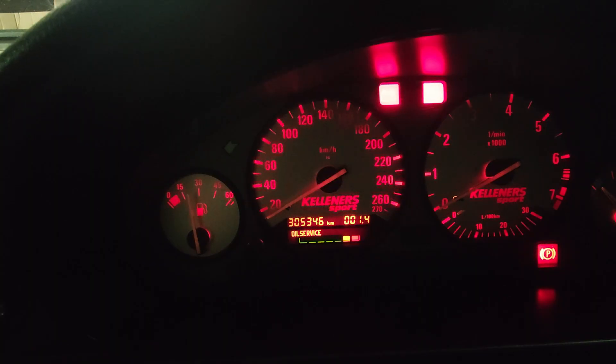So that was a waste of time advancing the cam back to stock. Apparently the retardation I had done was already very good, because in the logs now with the stock straight setup it's clearly making less power. I just went back and tapped it back the other way — retarded it again — and it was clearly shown in the logs. Full load at the top just felt lazy. The stock straight-up timing with these regrind cams is not optimal.